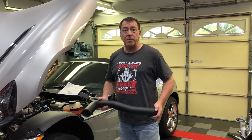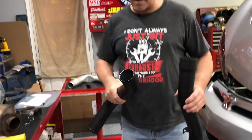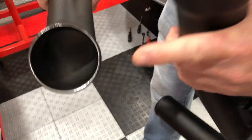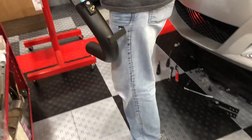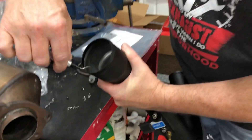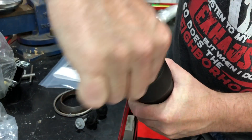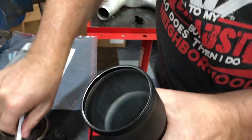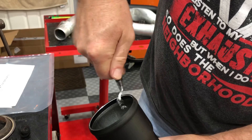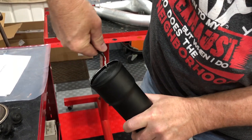Part of this whole process is to make this car look as inconspicuous as possible. As I've been going through and looking at these tubes, some of the cuts leave a little bit of an overhang and a sharp edge on the inside. What I've done is deburr these tubes. It's a pretty easy process — you take a little deburring tool like this one and simply drag it against the surface. It takes a tiny bit of the material off so that it gets rid of the sharp edge on the inside edge of that tube, creating a nice non-burred edge.